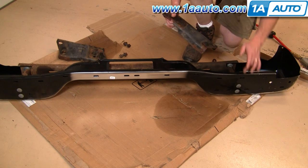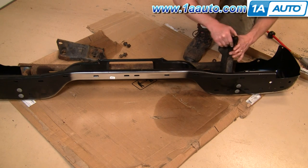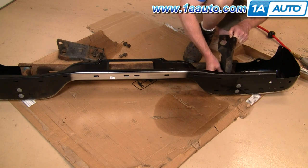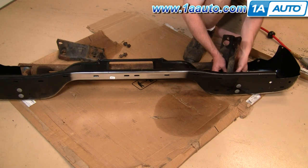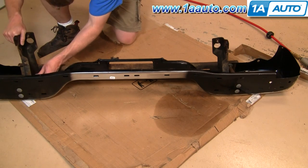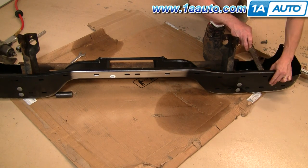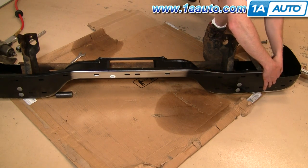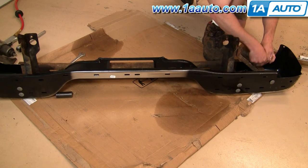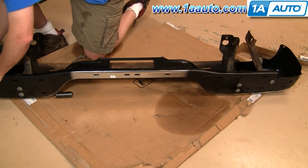Now, these are the main bumper brackets at the top of the bumper — they slide inside of this bracket here. I like to take the bolts and go from the inside out. Tighten the bolts enough so you can still move those brackets around a little bit while installing on the truck. The side braces just require two carriage-style bumper bolts each. Put these on and just like the other brackets, leave them just snug with your wrench so you can flex them back and forth.